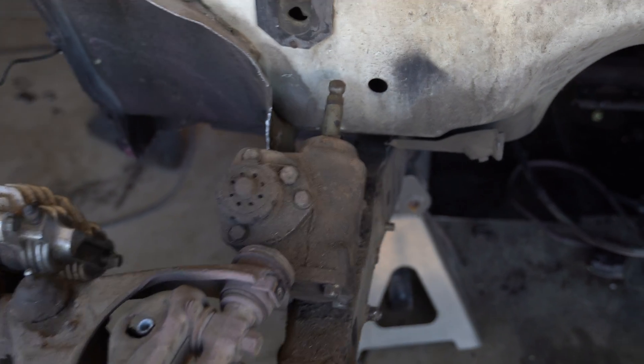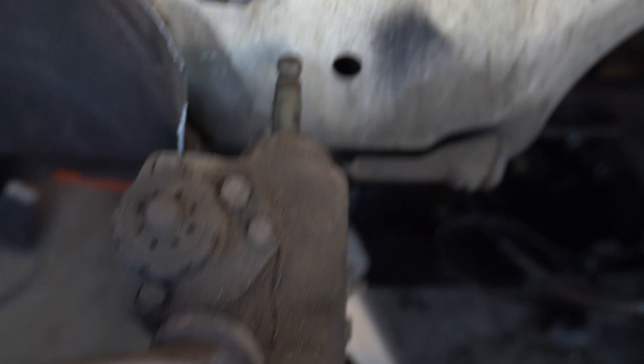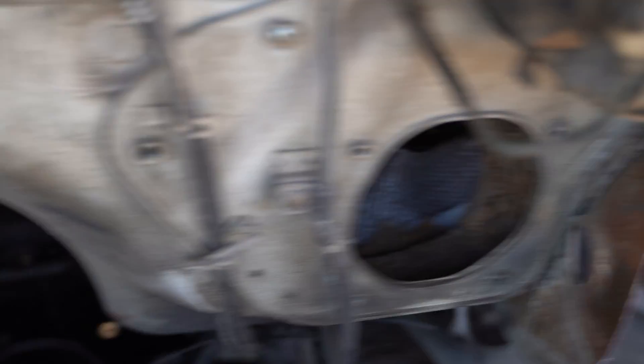Now if you're interested in doing right-hand drive, there are a couple of obvious modifications you'll have to do and some not so obvious ones. One, notice there's no hole in the firewall for where the steering shaft used to be — you're going to have to relocate that or make your own. Also, your left-hand drive dash is going to need to be swapped out with a right-hand drive one because your gauges will be on the wrong side, as well as the support under the dash that holds your steering column in place. And your pedal assembly and brake booster also need to be swapped to the other side.